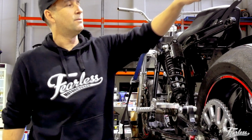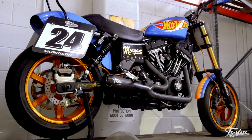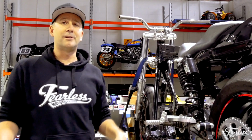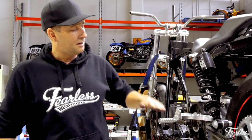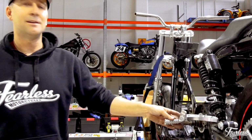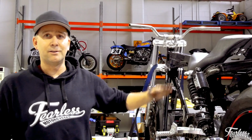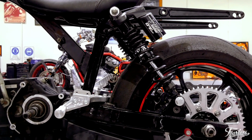The biggest thing as well, we've had to get seats made up, which on Alan's bike up there is the bigger seat, just higher. These standard seats are designed to be nice and low to the ground, but we've raised it up so the actual distance between here and where you're sitting means you're not cramped up. Otherwise your knees will be up into your ears. That was the same distance that I run on all my superbike race bikes, so that's why I designed that, and it was perfect.